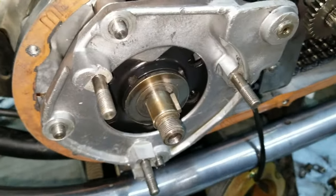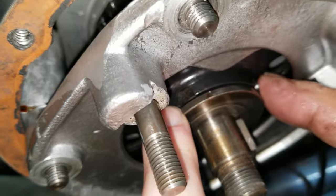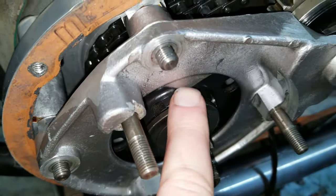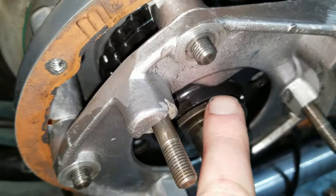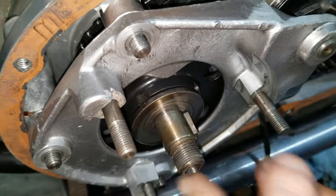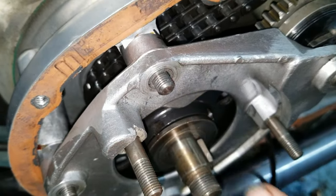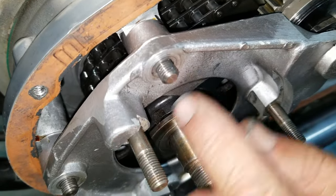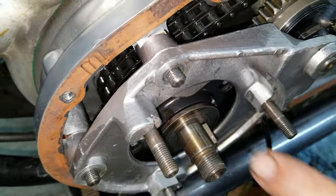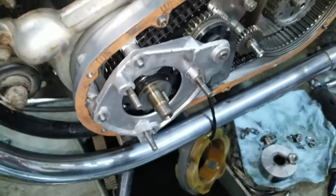And see, that's how the drip here works. Yeah, it comes down and it falls into these four holes as this oil builds up on it, and then it drips off there. I mean, it's an easy concept here. I got the key in it now, but I could have pulled it back. But you've seen that piece I slid in, and then there's the bearing inside of there, and that's got a spiral groove. As the oil goes in there, it spirals itself into the sprag, so the sprag gets oil. It pulls it all in.